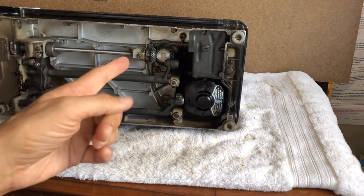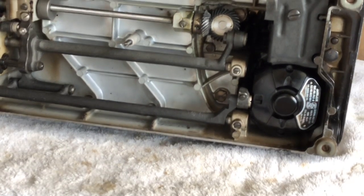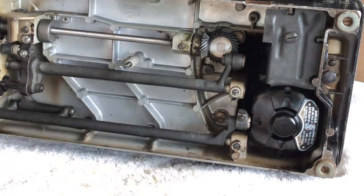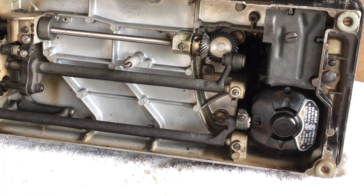While we're under here, you can see the underside of a 301 has wonderful, beautiful, high-quality steel gears — just like the differential on a car, it's all steel. Later designs would use belts to connect these two, which is not as strong or as exact. But 70 years ago, they were still using steel gear sets in the drivetrain, and this is why they lasted. This is what you're looking at: the guts of what makes an heirloom quality machine.